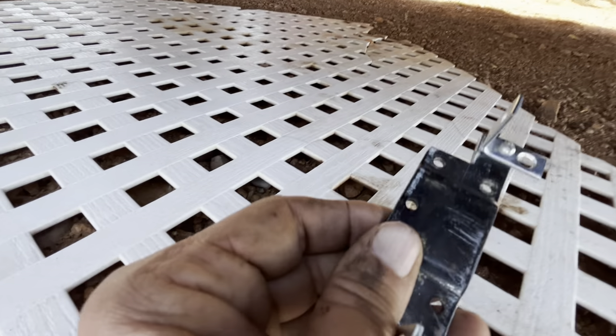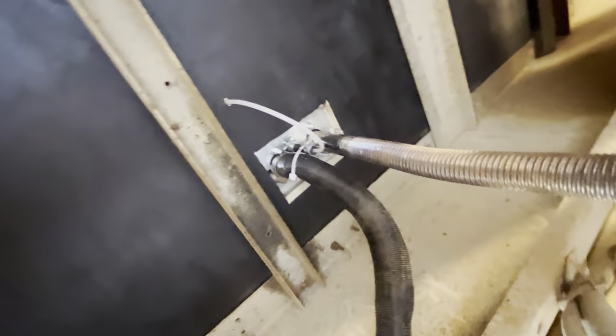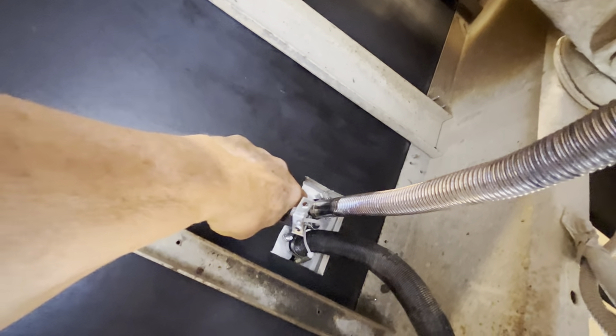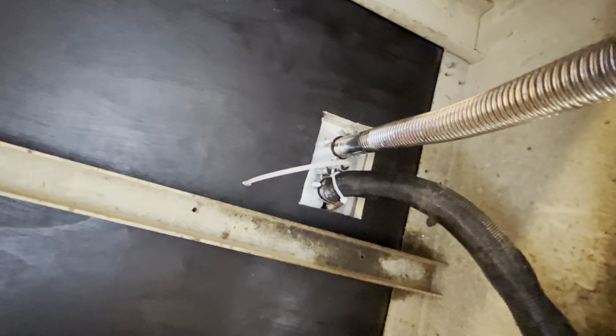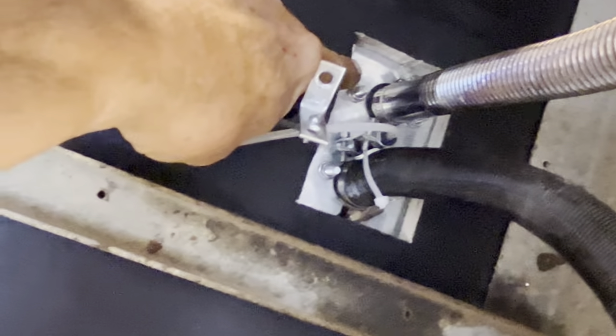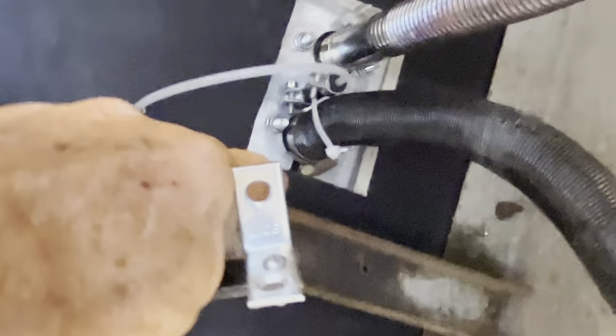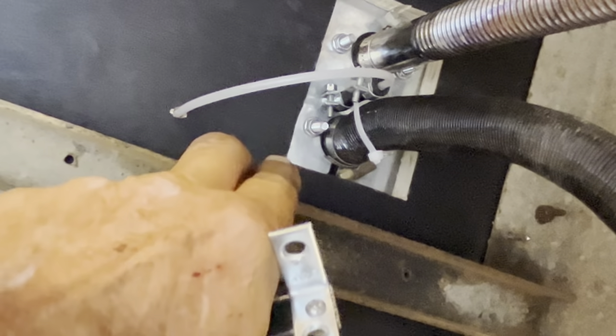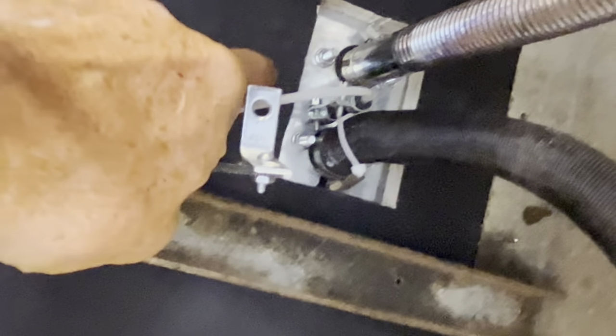I'll lay down here under the bus. I've got the exhaust coming out here. This exhaust pipe gets hot but I'm not worried about this wood here getting hot — this is my third diesel heater I've installed. I've been working with these, so I kind of get it away from the exhaust pipe right there like that. This is three-quarter inch wood right here.